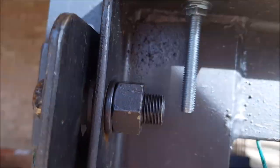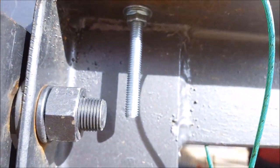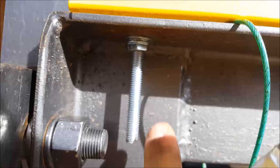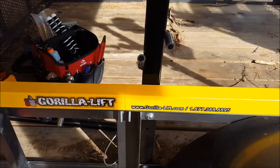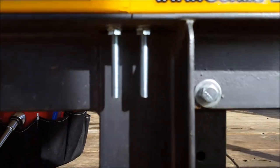You're going to want that bolt inside to be as flat as it can be — you don't want that spring getting caught on it. Put the washer and lock nut that they provided, and that is a 13 millimeter nut. Screw that end in.